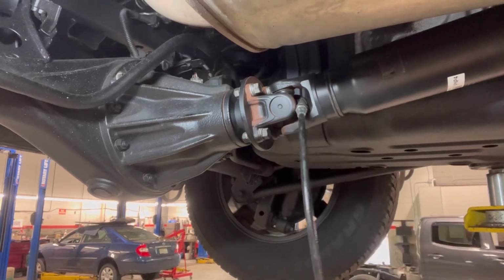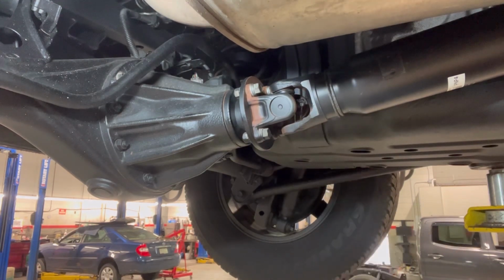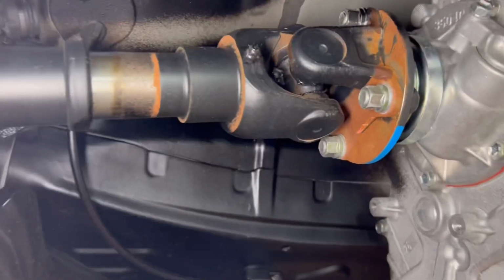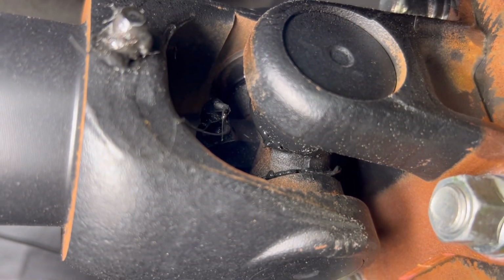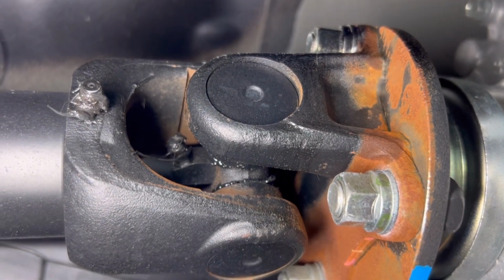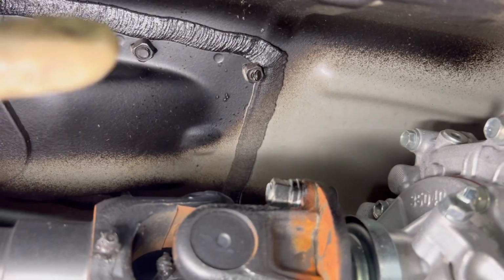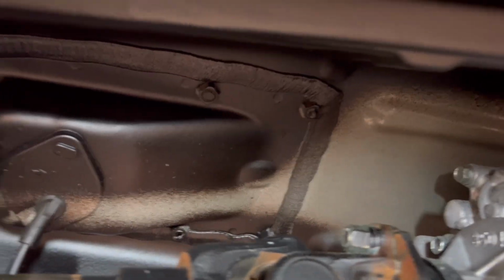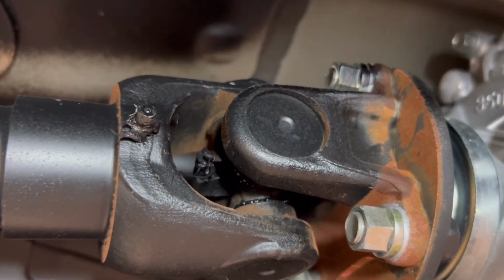Push it in. 3 to 4 pumps. 4. That's it. Nothing to it. Then, just showing you a close-up of the afterwards. This is kind of what you want to see. This is actually 1 pump too many, but then again, totally up to you. All that's going to happen is that this extra grease will just end up on the bottom of your undercarriage, which is totally not the end of the world. So that's what you're looking for. This is what you want to do.